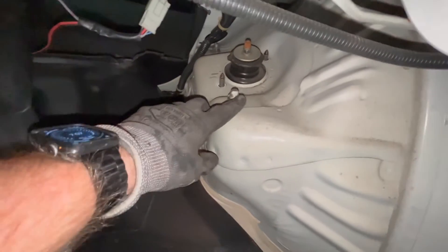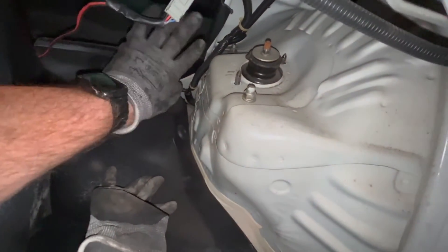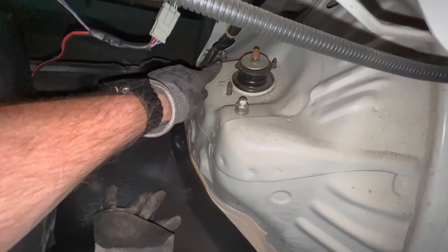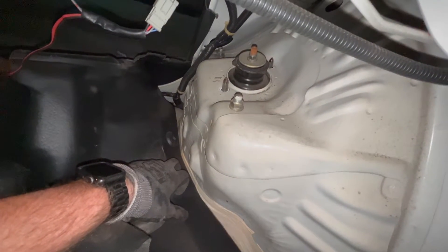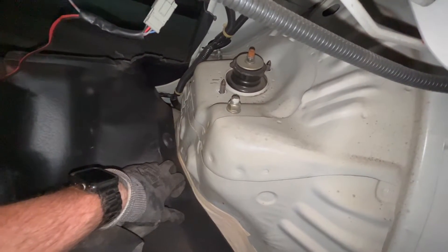The control arms are connected here and there's one in the front. There's an access panel — we've got the seat folded down — and an access panel up front that gives you access to that bolt. You have to drop the control arm because you don't have enough travel to get the coil out without taking something else apart. The easiest thing to take off is the top control arm.